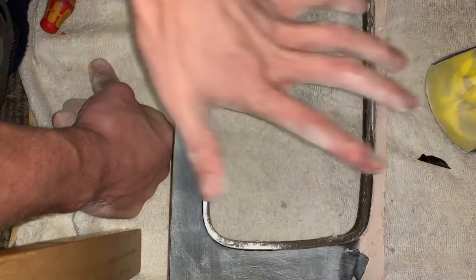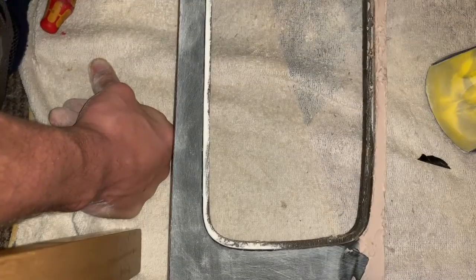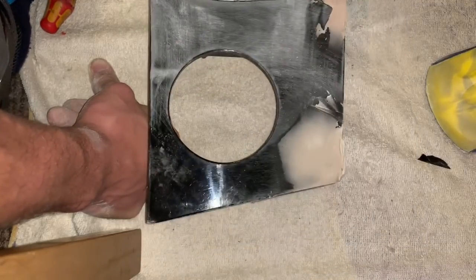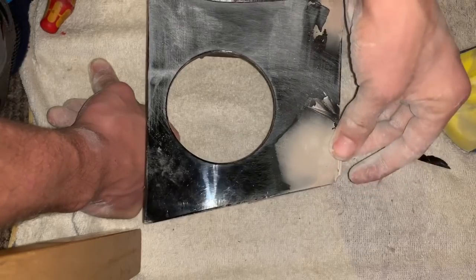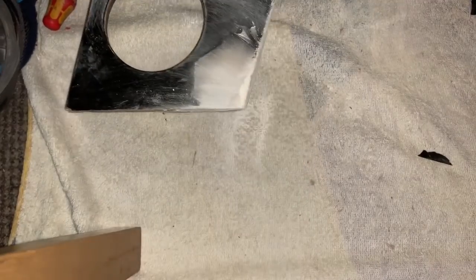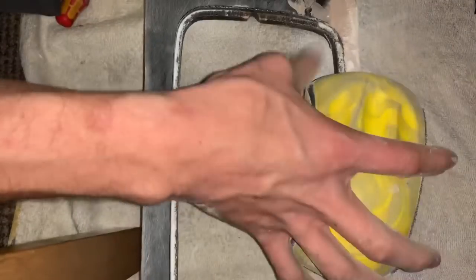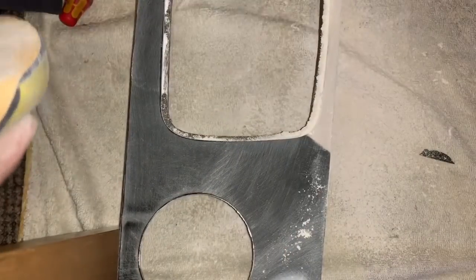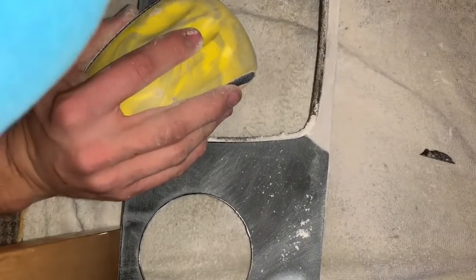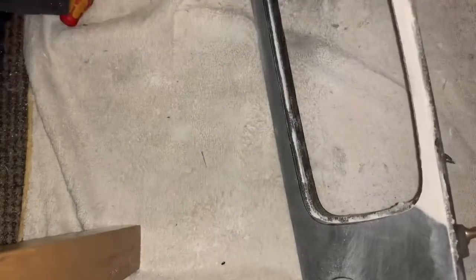If you haven't noticed, I have sanded the whole thing in 80 grit, apart from the glove box cover — I need to take that out and sand it separately. The one I filled previously has gone hard, so back on with the sanding. I'm just roughing out the shape with 80 grit paper and a sanding block, getting the really high bits off. As I progress through the sanding stages, I'll go on to 120 grit, 180, 240, and finish it all off with a 320. A 320 grit sandpaper should be a good key for some primer. It is a special primer for use on wood, and you can get it from pretty much anywhere — B&Q sell it.